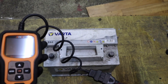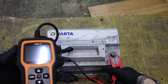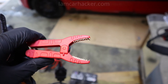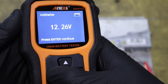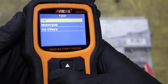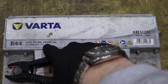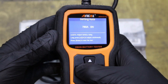I have a couple of old batteries in the garage, so let's try it. First thing you want to do is connect your red and black clips. I like that these clips can be really wide open, because some clips on battery testers you cannot open wide enough — Ancel has very good clips. You just connect them to the battery, go to the battery tab. Now you have to input details about which battery you are testing and also the size of the battery, and this information you will find on the sticker on the battery. Check it first and make sure you are inputting the correct value so you will get the correct result.